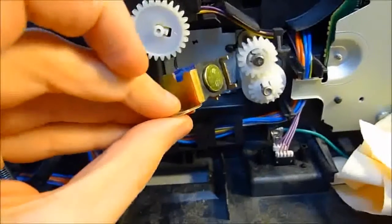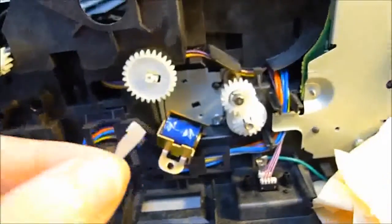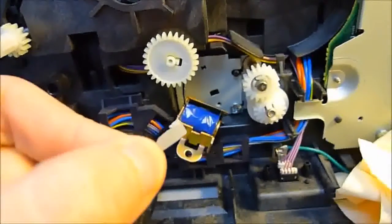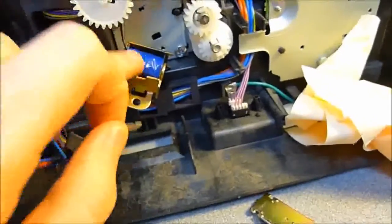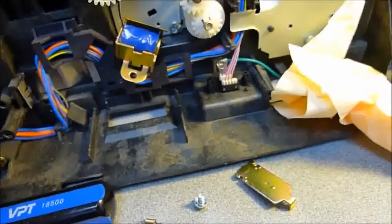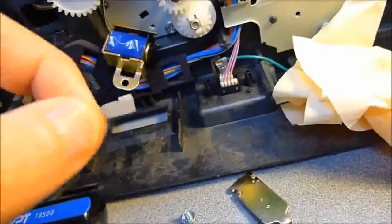We can see how clean that is. Now while I was doing this, I looked online and it seems that contrary to what I said previously, what we actually want to do is take some kind of piece of plastic or some sort of magnetic-resisting material and stick it back in the place where the adhesive used to be. The reason is that a lot of times people just clean it off and don't replace it, and then there's a problem with residual magnetism from the solenoid — it fires and causes the metal to still be slightly magnetic. All it takes is a microsecond of delay and the printer will jam. So I'm going to stick a little piece of tape back on there.